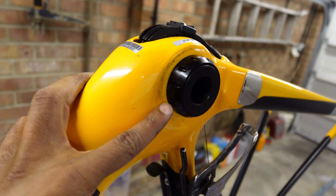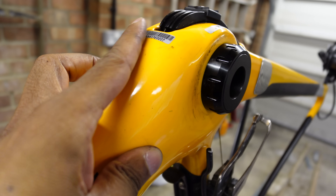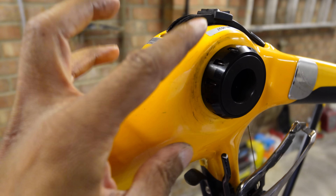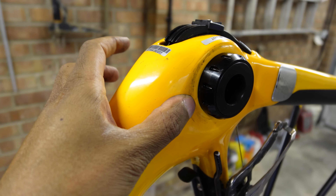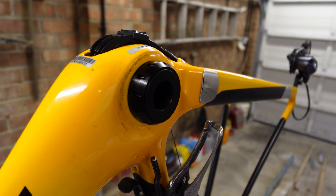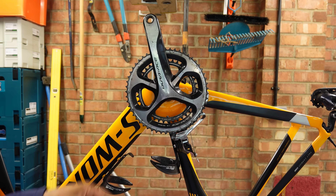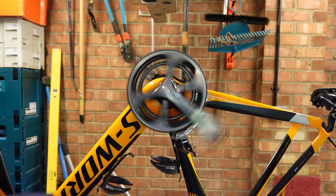To be clear so there's no doubt: this bottom bracket is held in the axial direction by the threads — it threads from one side to the other. Radially it's held in by a transition fit — up, down, left and right. To take out the irregularity it's also got retaining compound. It's not glued in. I've put a test crank in just to check it all works and there are no rubs. It's got fully sealed bearings so it doesn't spin that freely, but it's smooth — and that means it's a pass.